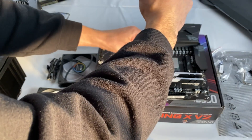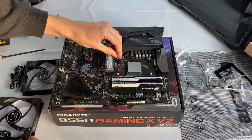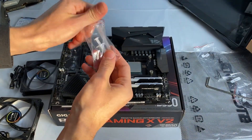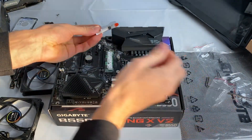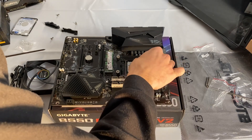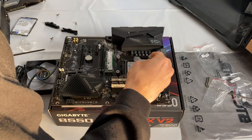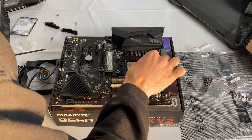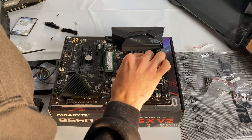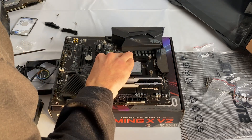The mounting process is pretty simple — you just have to remove the existing backplate so you can use the integrated AM4 backplate, which is actually nice. They also give you a nice spatula for the thermal paste, so just spread it out. You don't really need to spread it manually — if you apply it nicely it will spread out on its own. If you want to spread it, go in parallel lines; the edges will usually get covered on their own.